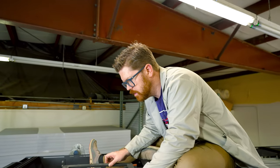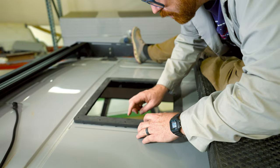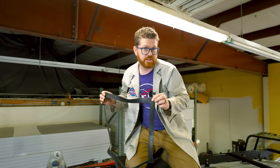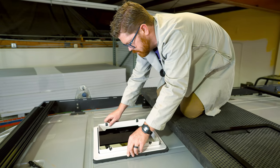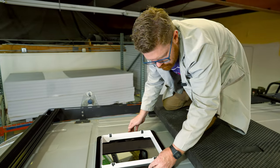Got our sealant in place — let's pull this down. I'm just visually sighting everything to make sure all my holes are lined up. Looks perfect. Our DIY Van flange is in place and now we're going to put down the gasket that came from Van Project One. Then I'm going to place my Max Air Flange adapter and finally the outer matching ring from Van Project One.